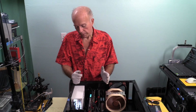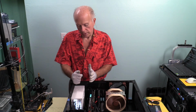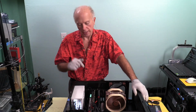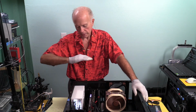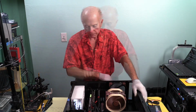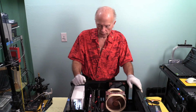You've seen what we've encountered as we went through this. If you were to put a 3090 in this second slot, because it takes up three slots, you're going to have to figure out some way for your... you know what you're going to have is a right-angle USB 3.0 connector, that head of that 19-pin/20-pin. You're going to need a right-angle connector, because that's got to get down and can't be any higher than a heatsink that's sitting across where two NVMe drives will be on the end, because the video card's sitting on top of that. PITA. So anyway, we have the resources. We have three usable slots. Slot number four is not. We changed the video card. You guys see what we're going on, what we're dealing with.